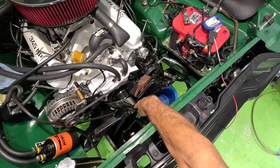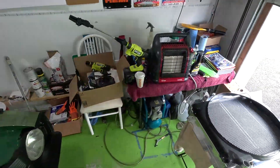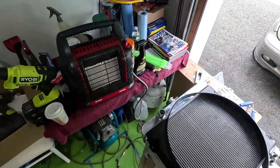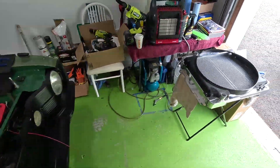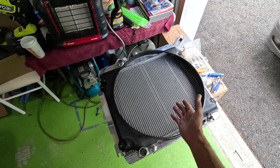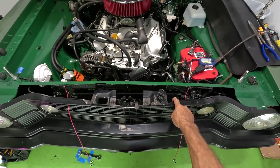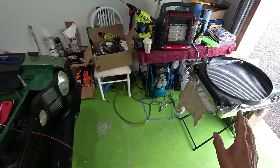I'm not going to put a new spacer in here because that requires longer bolts — at least an inch and a half — and I don't have them. I do have threaded stainless steel rod that fits, but I'd have to cut it and find nuts, washers, and lock washers — that's a lot of work. I test-fitted it and it's exactly the same size as the one that came out. I'm keeping my fingers crossed that the old one was just clogged. We also lost about 10 pounds with this aluminum radiator, and another 4 to 5 pounds with the electric fan I removed.